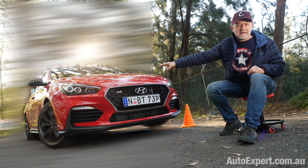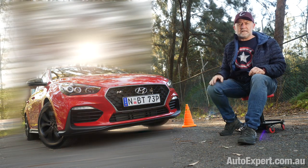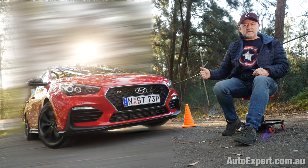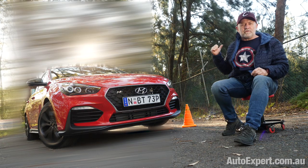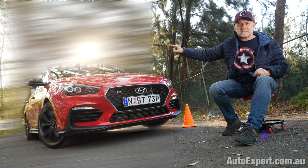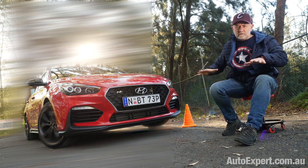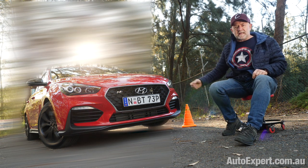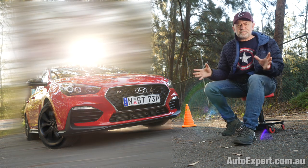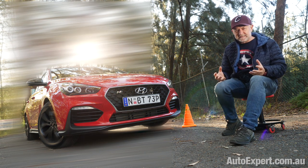When you've got a lot of drive happening on the right-hand side here, it makes the car yaw to the left. And we're turning a left-hand bend. So this left-hand yaw needs to continue for the other 45 degrees of our 90-degree bend, and the e-diff is helping that yaw because there's an unbalanced amount of drive happening on the right-hand side, causing rotation in the plane of yaw about that vertical axis and helping the car get around the bend. So I hope this explanation makes some sort of cogent beer garden physics sense.